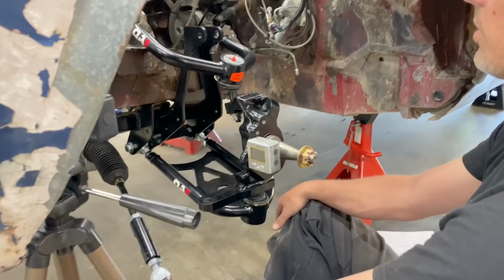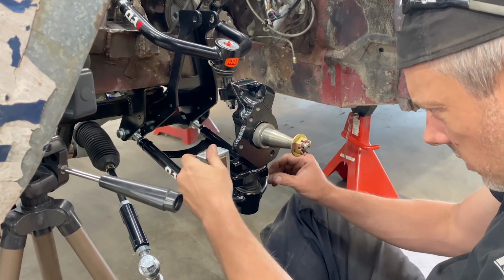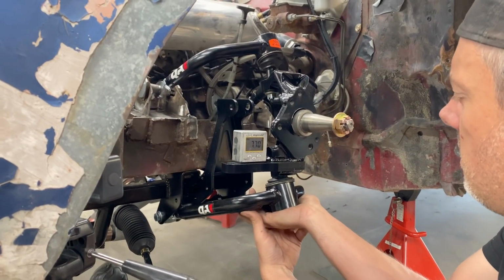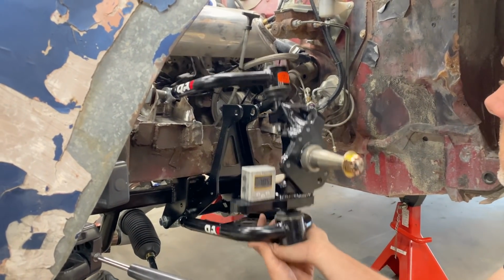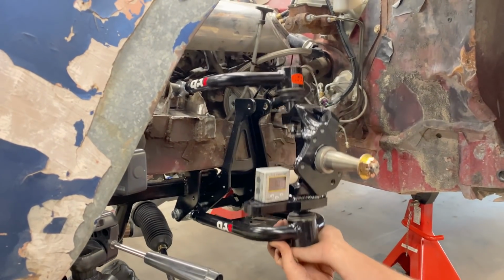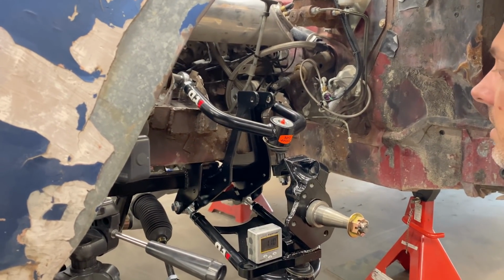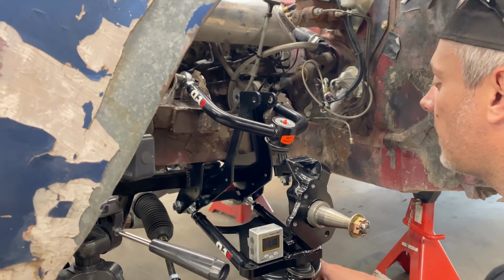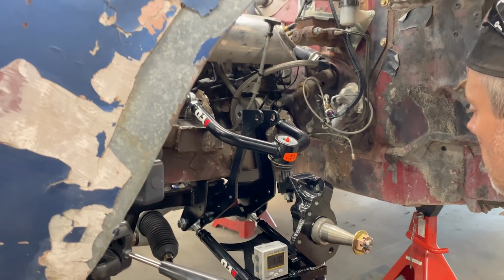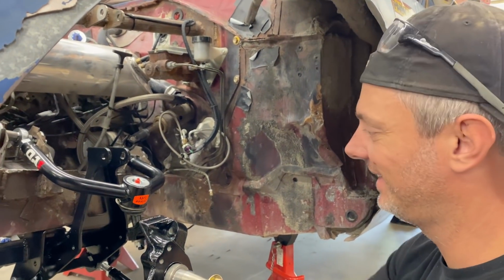And we still have some more we could kick out in the bottom. Caster is 0 there. And 6. So we're still gaining caster. So that's good. I think maybe we can slide the bottom out just a little bit more, and I think we'll be all right. It's not perfect, but it's way better than it was. This was a mess before.